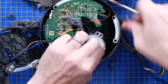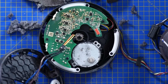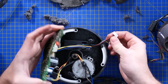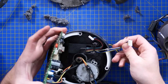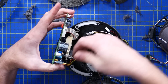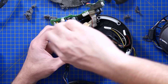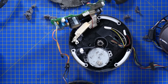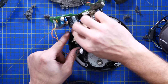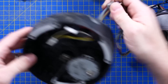First look inside — that's going to be a motor with a built-in gearbox. Dyson always do a nice PCB. I seem to remember the one on the robot vacuum cleaner was heavily conformally coated and we couldn't read anything. Based on the dusty environment, this is going to be very similar. Connections: main motor, possibly PSU, motor for rotation. The PCB at the front will have the IR sensor, a power board, and drives a little LCD display — the speeds were represented on a two-digit seven-segment display.